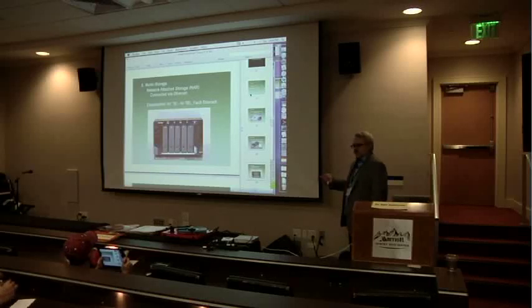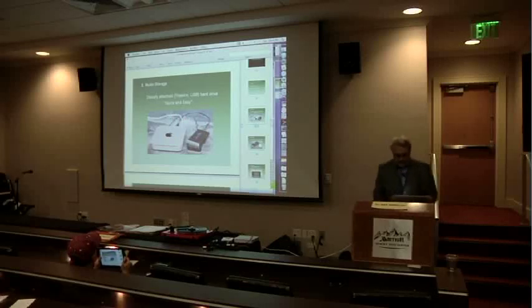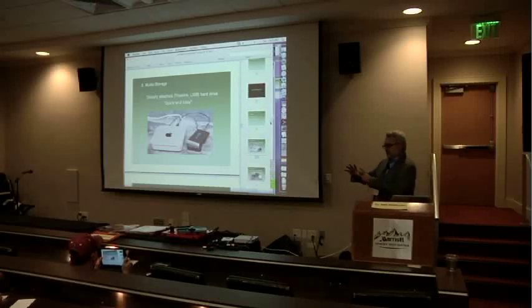If the power is interrupted on one of these devices at the wrong time when it's going through a write operation, you can lose the whole array. So you want to keep it backed up, and you want to use an uninterruptible power source. And there's an example of an external bus power drive, but I wouldn't really recommend these because they're really, really slow. It'll make the work frustrating. But you can get wall wart power drives that are really fast, connect via Thunderbolt or USB 3, which are ideal for this purpose.